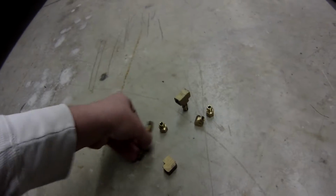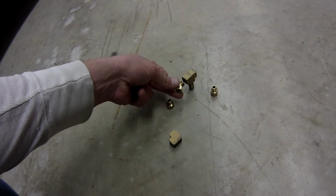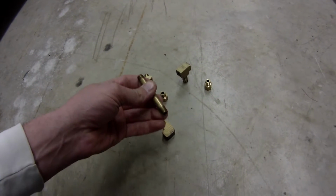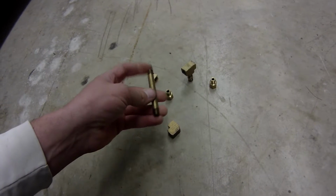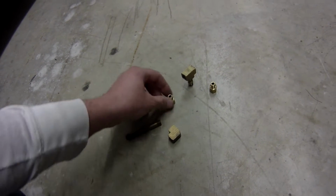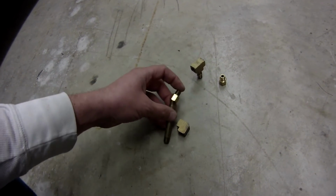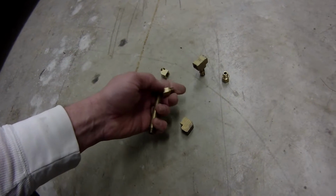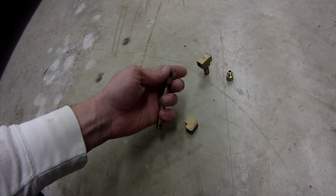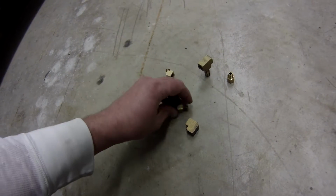I still have that. This pipe, this is going to come off with a 45 hooked to this pipe. I didn't want black pipe. I really wanted to keep everything brass, so I couldn't find a pipe in just over 3.5 inches. So as much as I hate to do this, I'm putting this extension nipple on here, and like I said, I hate to have more threads than I have to, but there really isn't much I can do about it.